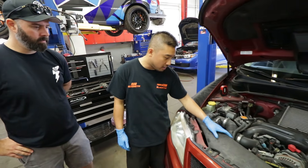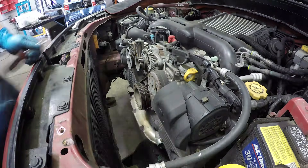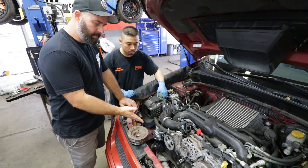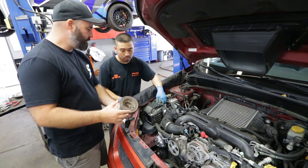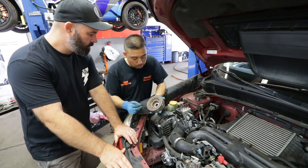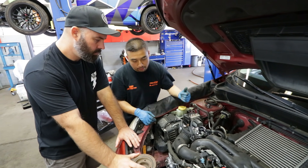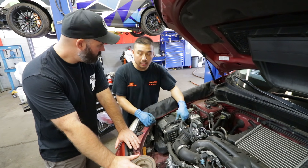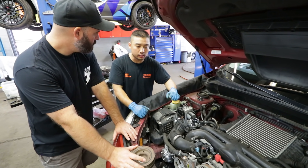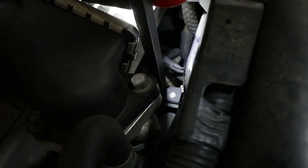First, we've got to start taking off all the little parts like the air intake, some of the accessory belts, drain the coolant, then get to the timing covers and get all the accessories off, then we'll get to the belt. Now that Nam's stripped everything out of the front, the belt's exposed and the crank pulley's off. There's a difference in procedure for removing it on a manual car versus an automatic. On a manual you can stick a screwdriver in the bell housing and lock up the flywheel, or put it in fifth gear and step on the brakes. But on an automatic, we had to stick a pry bar down to the flex plate to hold the engine and crack it loose that way.